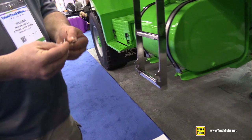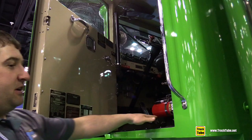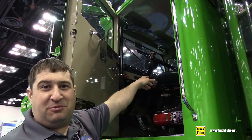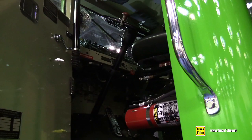These still have the original keys they came with in 1989. The cab is pretty much entirely original. Oshkosh trucks have three heating systems: an auxiliary heater underneath to keep the driver warm, one heating system just to keep the windshield heated, and another for the side windows. They also have side wipers — this particular truck has one on the passenger side but not the driver's side. The seat is a Bostrom 710E, which is famously the most uncomfortable seat in the world. You have an air select switch right behind the steering wheel to kick in and out of four-wheel drive.